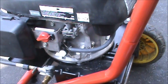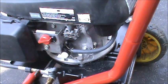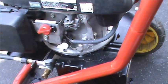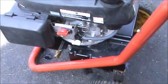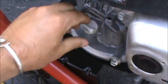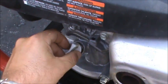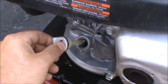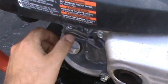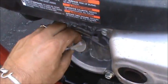If you're having this problem, one of the first things you want to look at is your oil level. If the oil is overfilled, it's going to leak out there on any of these vertical engines. You think you know how to check the oil, but you probably don't — you've got to look this up in the manual. When you loosen up the oil dipstick, clean it off. You do not screw it in to check it. You put it right in like this, then pull it up and look at your oil level. A lot of people screw it all the way down and keep adding until it's full, and you're going to overfill it — and that's going to be a problem.